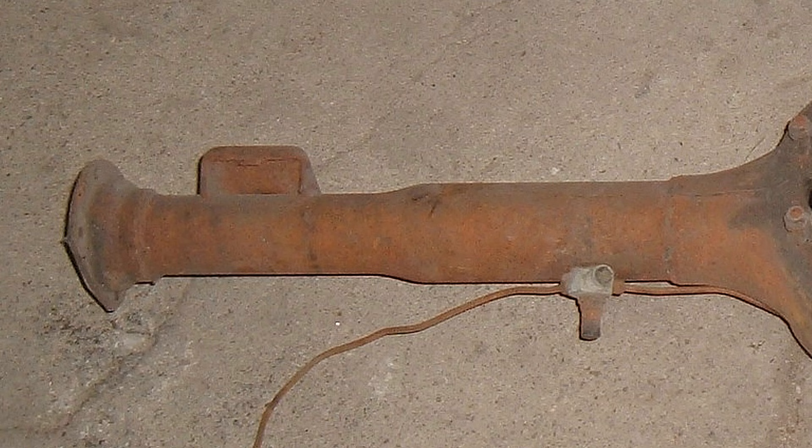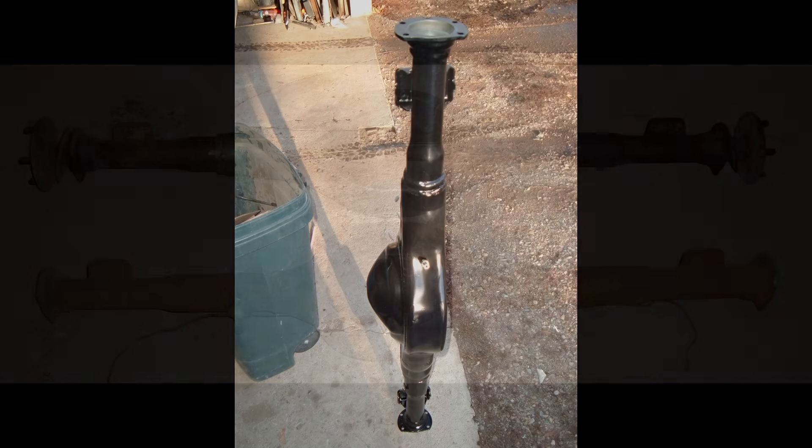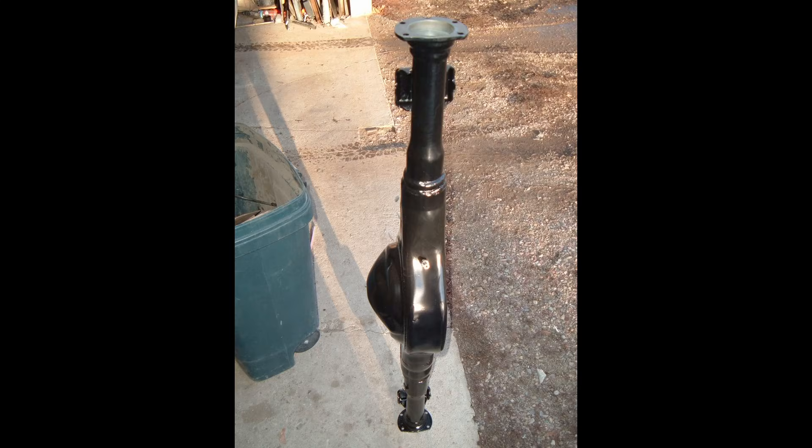The other advantage of going DIY is cost savings. Plenty of places out there will narrow up a rear-end for you, but getting one inexpensively is simply not going to happen. This video is about how I took a Ford 8-inch rear-end, used the axles, the axle tubes, and then the center section out of a Ford 9-inch housing, and grafted that all together to make a period-correct Ford 9-inch rear-end.